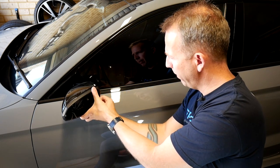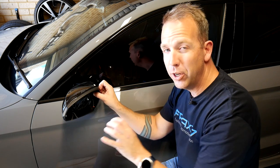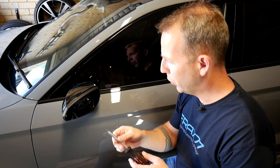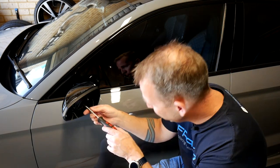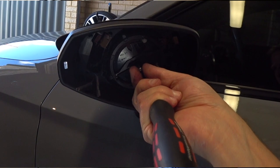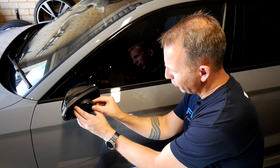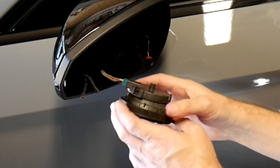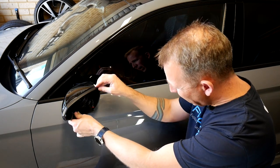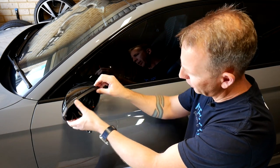Work your way from the inside first — there's one clip gone. You only want to get it just a little bit loose so it's kind of hanging off the edge. Then there's one more screw to remove and it's right in the middle of the mirror motor — again it is a T10, a really long one that's pretty easy to identify when putting it back. That central motor just kind of pops out. At this stage you can just leave it hanging — we don't need to unplug it. Then keep removing the plastic trim around the edge and just gently let it hang down by the side of the car.